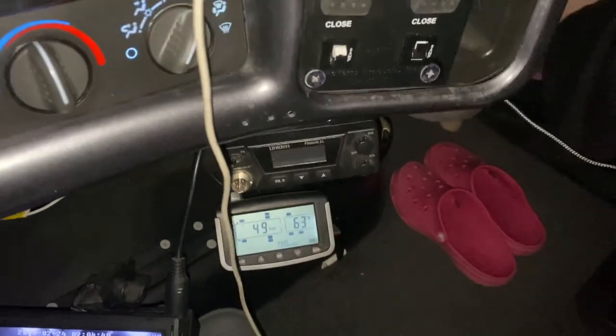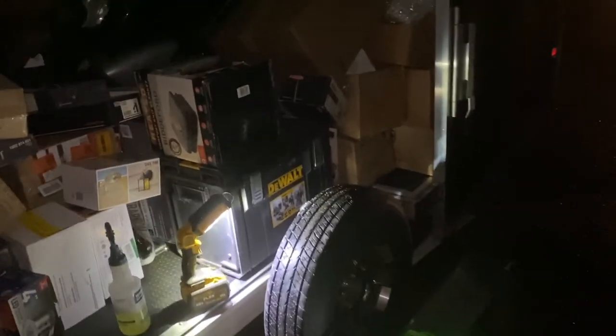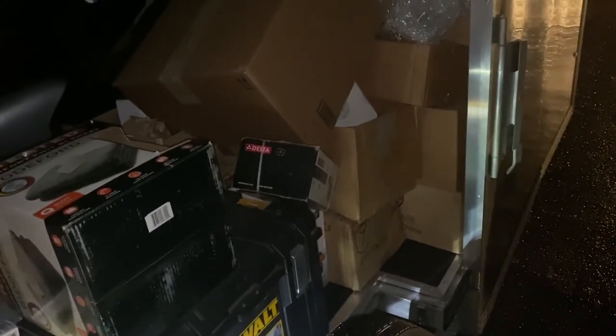So if you can pinpoint the hole, rotate your tire to where the hole's facing downward. This is not working. It continues. So I got the patch kit from Walmart. And thank goodness this trailer has this escape hatch door. I'm able to get to the tire on the inside without taking it off and patch it properly. So that's what I'm gonna do.